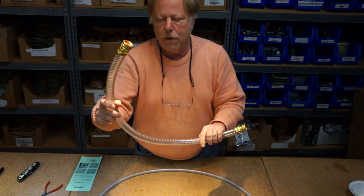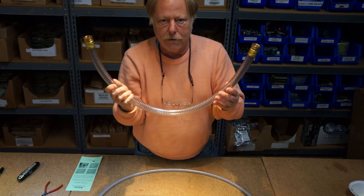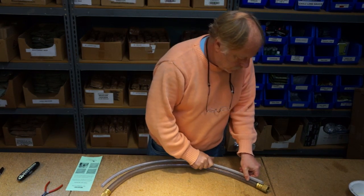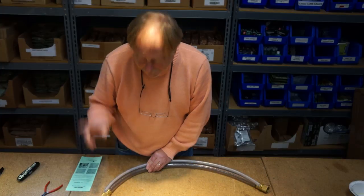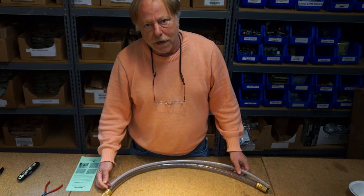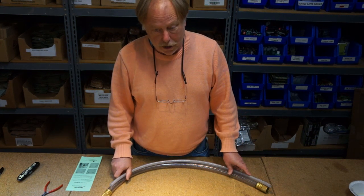So this tubing will fit the current one but it needs to get cut shorter for the older one. Likewise, if you're going to install it in what we call the garden-style hose — one they stopped using a few years back — this tubing is going to be too long for that one. What you want to do is take your existing hose, place the tubing on top, and on this end you want it right between the two brass parts. Line up your tubing, mark it, and cut it short of where the brass part is. The reason is you're not going to physically be able to put it through both fittings — you just insert it on one end and it stops short of the other fitting, and that completely works. They've already tested it like this and it makes installation a lot easier.